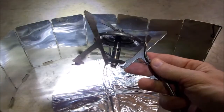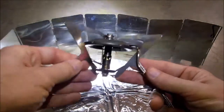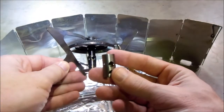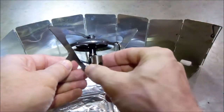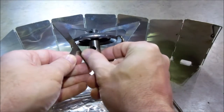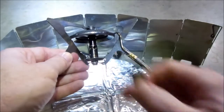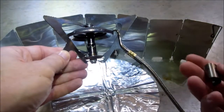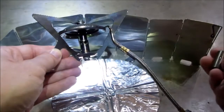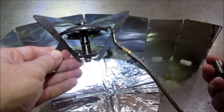There are two ways to combat that. One way is to open up the jet, which pushes more fuel. Or, some guys have used what I call a dampener system — a sleeve with a little hole in it that you put in here and turn to regulate the air flow. That's used with a standard white gas jet.